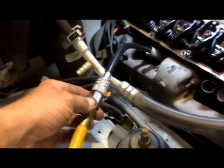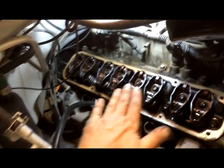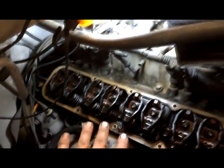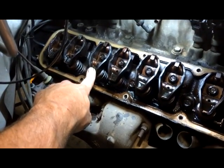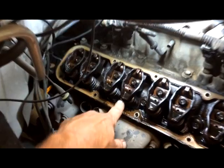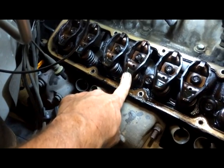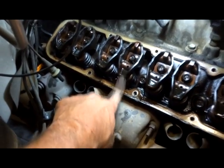Now we've got the hose hooked up and air coming in. The hiss is important — where it's coming from. If we hear the hiss coming from anywhere in the intake side, the plenum, any of the vacuum hoses, or even at the top, that would indicate an intake valve problem — a seat problem or some kind of seal problem with the intake valve. If we hear a hiss coming from the crankcase way down at the bottom, that's the worst news — it could be a problem with the rings or the lower end of the engine. But if you hear a hiss coming out the tailpipe or the exhaust, it could be the exhaust valve — usually the seat gets burned. I've already crawled underneath, and I believe it's the exhaust valve. Let's go take a listen.